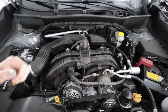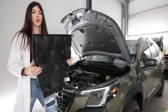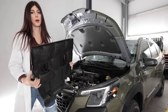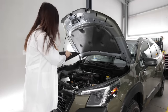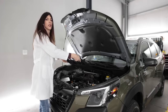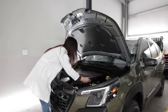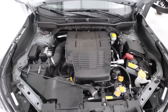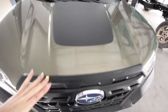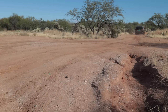It's still the same great recipe of a horizontally opposed flat-four keeping the center of gravity nice and low and creating some fun sounds with that boxer rumble, but it's changed a lot over the years. Now it's got a plastic intake manifold. One thing these are susceptible to is carbon buildup on the back of the valves because it is only direct injection with no port injection to help keep them clean. I'm going to be doing a video on walnut blasting my intake valves on the Forester. All they need to do now is offer a turbo version.